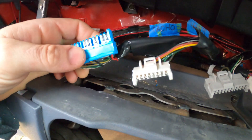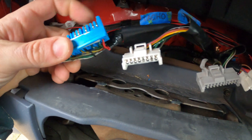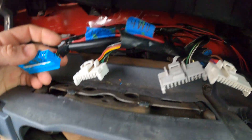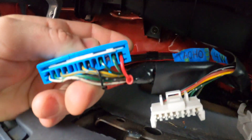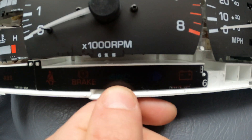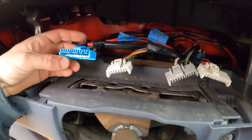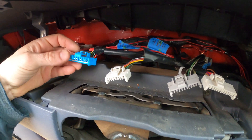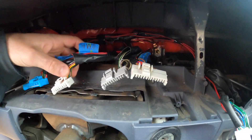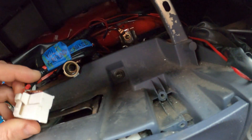Here's the stock connector piece. The other wire I added was for the four wheel drive light — that's the red wire all the way over there — which makes the four wheel drive light here light up. The cruise control light wire I did something similar for. So on the far left plug you add the wire for the tach. The two middle plugs remain unmodified.